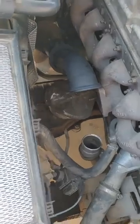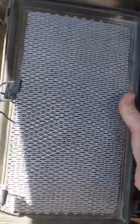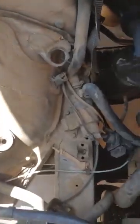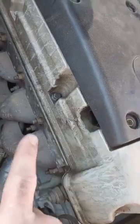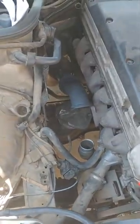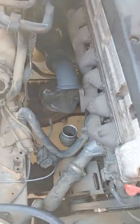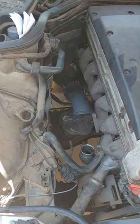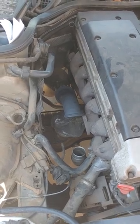The air filter, like I was saying — if you have the housing top off, the air filter just mounts right here just fine. If you wanted to remove the housing completely, it just pops out. Then your air filter has that pipe that you can put over it if you wanted to get it away from the engine and take advantage of the stock air inlet somewhere right here. The hose for the ventilation comes out here and you can hook it onto that blue tube. So that is everything. There's no welding — about 30 seconds of angle grinder is the only thing you have to do. Everything else just bolts right on for 300 horsepower with Sean's Stage 2 tune and stock EDC pump.